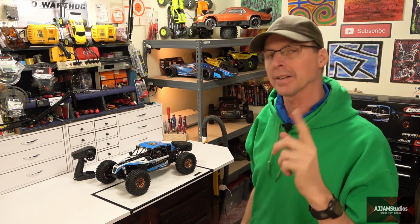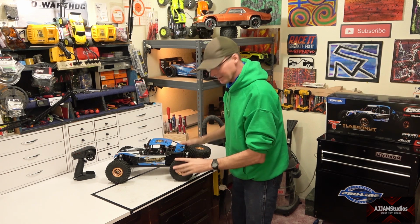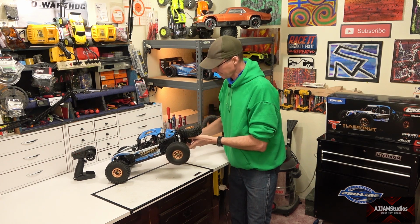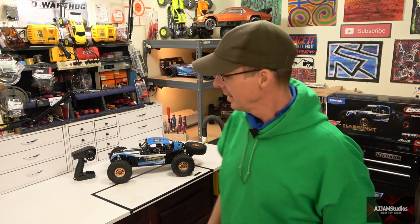So this rectifies that. Also, while I was in there, I went ahead and got into the rear differential, and I stiffened it a little bit. It's still open. See, it still spins just like a normal open one would, but it's got a bit more resistance in it, so when you get into looser stuff and pin it, it will work like a posi, and it'll help it come around.